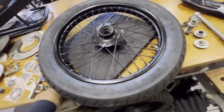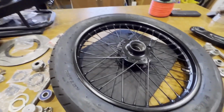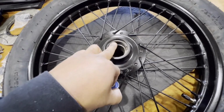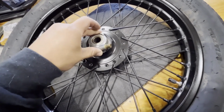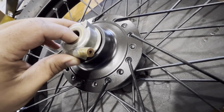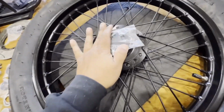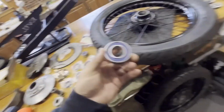So I'm going to have to do a little bit of research here. So we might not be getting very far in today's video, but at least we got the bike painted. So that's not a bad thing. But I'm going to have to try to figure out. The other part, too, is these bearings honestly really don't even fit. As far as I know, the bearing should sit under here, and then should be a couple other pieces, and then the speed sensor just sits right on top. So there'll be a little bit of a collar. Pretty sure there's a dust shield that goes in there, and then that should sit right there. And I cannot do that. I'm actually pretty sure this is what sits there. Yeah, that should fit right on top of there and be good. But yeah, these two bearings here, no bueno. This one here, I'm still pretty sure this is for back here, because it does fit that axle.